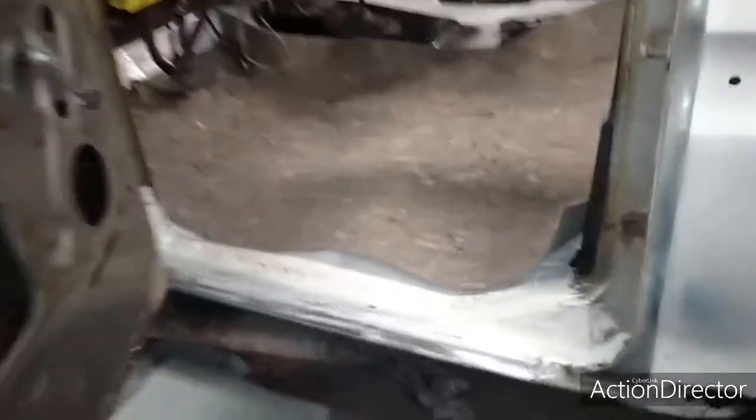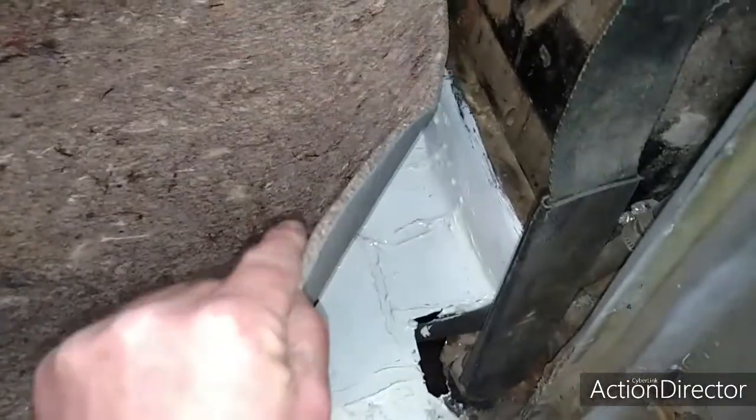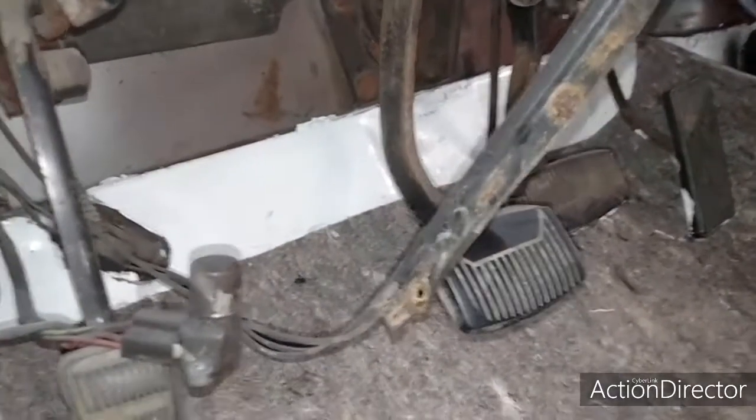So this is what I'm using - this is called felt pad. Luckily I have some left over from my good old carpet installation days. First thing you do: make sure your floor is clean, take a rough measurement, and cut a piece to kind of fit. Line it up to where you want it. I see I've got to make a little slash over here for that brake cable and another little slice over there for the clutch pedal.